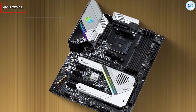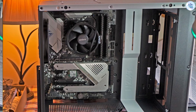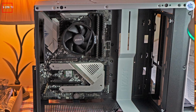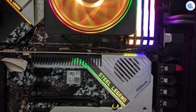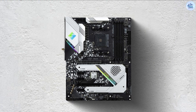Above those are 2 four-lane PCIe 4.0 M.2 slots, 8 SATA ports, 3 PCIe x1 slots in addition to the x16-length slots mentioned above, and the PCH heatsink. A small integrated circuit poking out from under the PCH heatsink is an ASM1184 PCIe 2.0 x1 to x4 smart switch, which allows the Wi-Fi and gigabit Ethernet ports to share the chipset's one remaining PCIe lane.